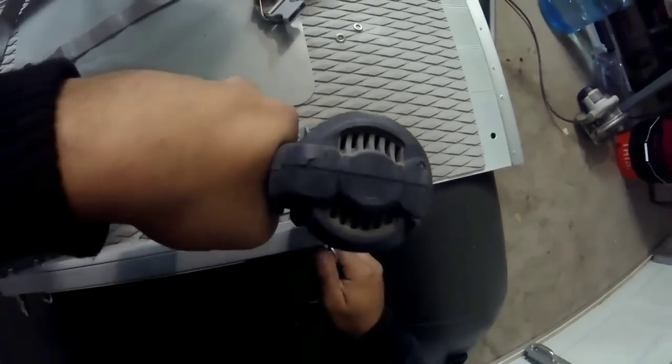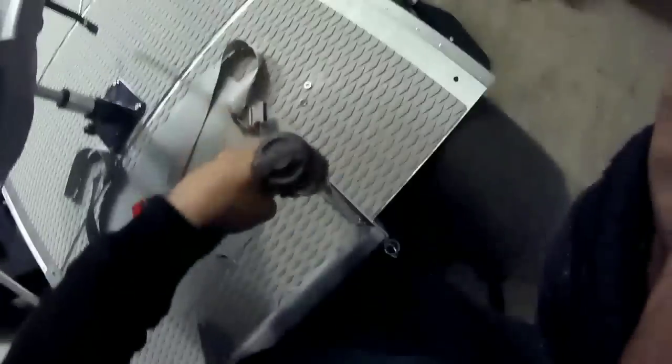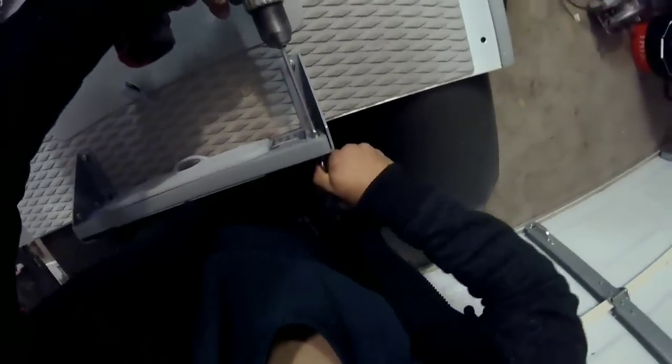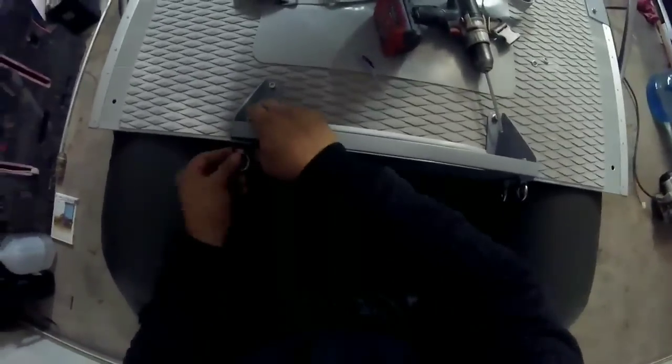And make sure the bottom bolts are secured way before you secure the top bolts where the ring nuts are, or the holes for the bottom won't align properly. Once the bottom is properly secured, then you can tighten the ones with the ring nuts on them. And then that completes the transom. Very nice, solid transom. Has a lot of good qualities that I wish other boats had.